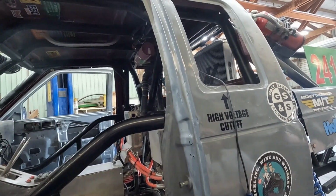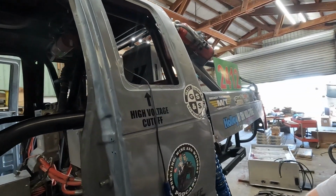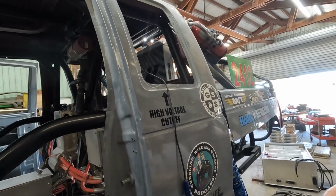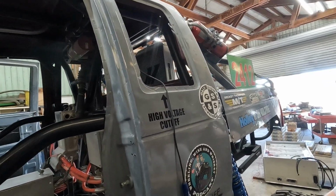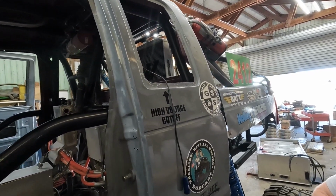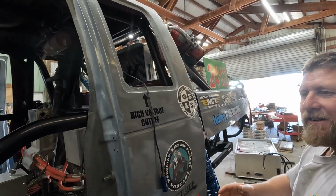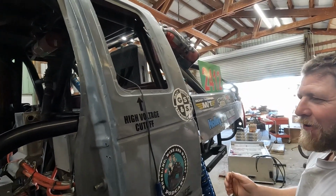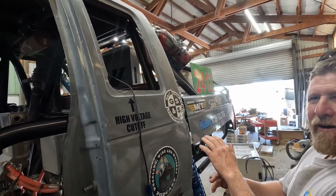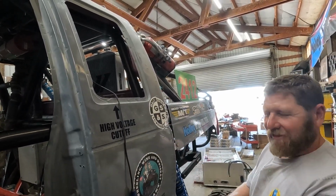That's really cool. And then we can go into double low range when we kick both transfer cases into double low. The benefit of that is to put the power where you need it, but also you're not having to split the power, right? So if you put it all to the rear, then you're getting more power to the rear than if you had it going to all four. You can just shut it on and off. There's no variance in it. Okay. But there's what we like to power dig over when we get in the rocks. So we'll get over and get the back tire bound up, and we'll just kick the front end over and basically light the tires off and slide it around.